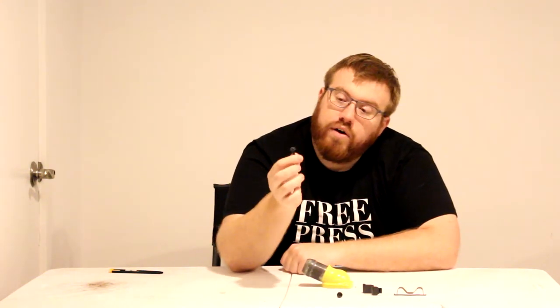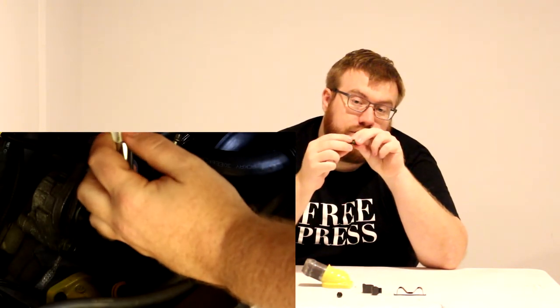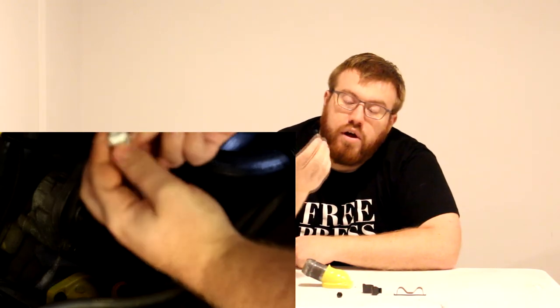I'm sure you're thinking, Steve, why did you paint the bolts? If you tighten those down, you're just going to chip the paint. Well, there's a trick that if you use a socket that's a slightly bigger size, like not even 10 to 11 millimeters, like going from metric to SAE, the slightest bigger size, then you wrap electrical tape around it so there's a soft cushion when you go to torque it. And this won't work on high torque bolts, but this is just a water outlet, so you can use that trick to tighten these down to a good tightness without chipping the paint.